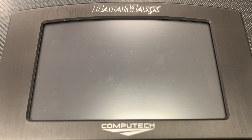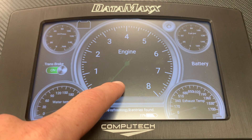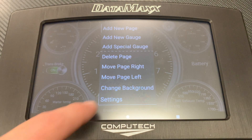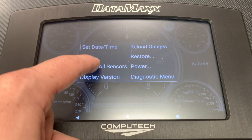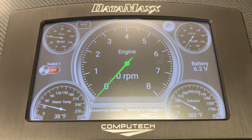Step 3. To do this, turn on the system, then click and hold anywhere on the screen and a menu will pop up. Click on More Options, then Settings, and finally select Forget All Sensors. The screen message area will likely say Discovering Sensors, and then Sensor Discovery Complete. Congratulations — you can now start customizing your screen however you like.